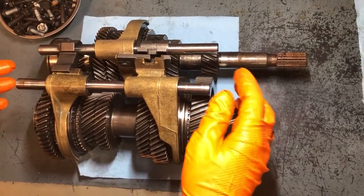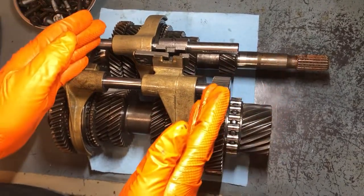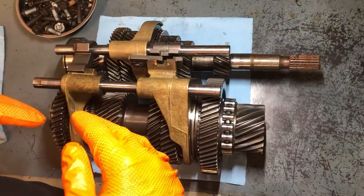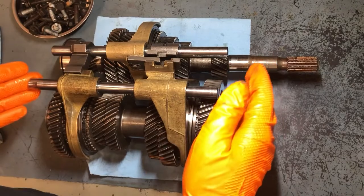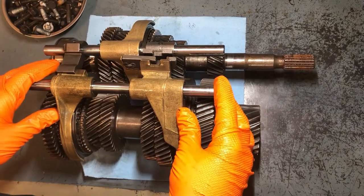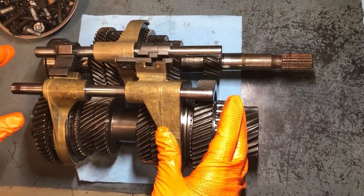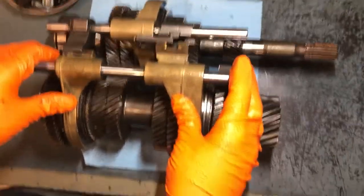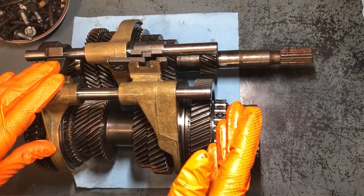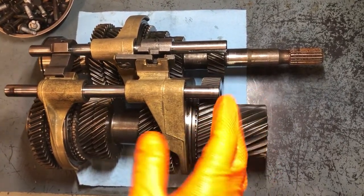What I found out with mine so far — I got super lucky, I had a weird issue. My third gear would mysteriously appear and disappear. I could put it in third and it would go in perfectly, other times I'd put it in and it would be in neutral still. It just wouldn't catch, or it would just lightly graze the gear — a really weird, wacky issue. Also, my second gear was grinding pretty much no matter what; unless you were really careful with the rev match, something was going on with second gear.